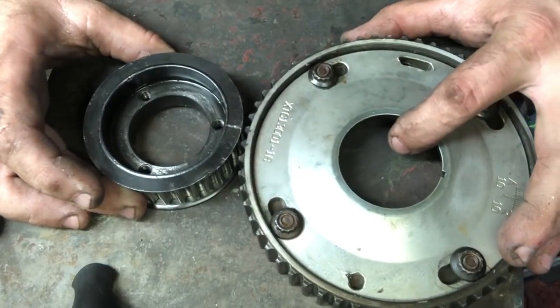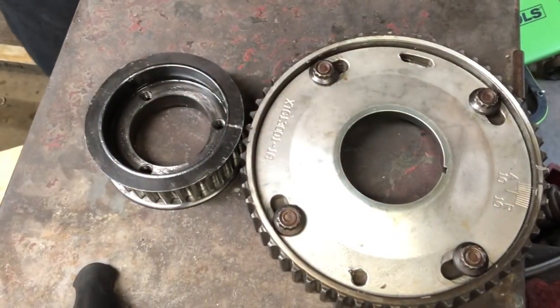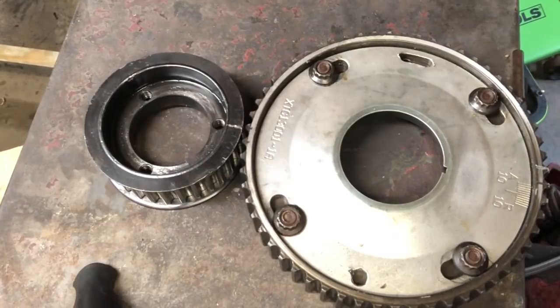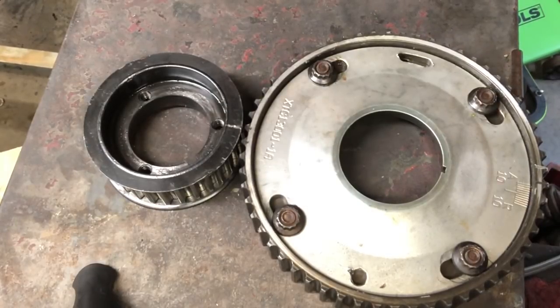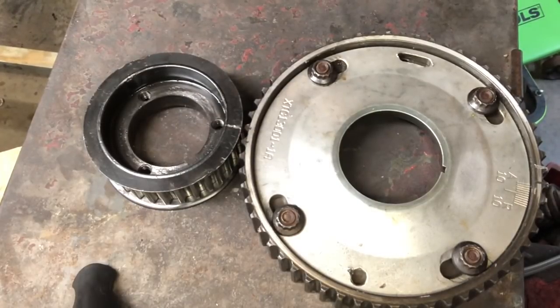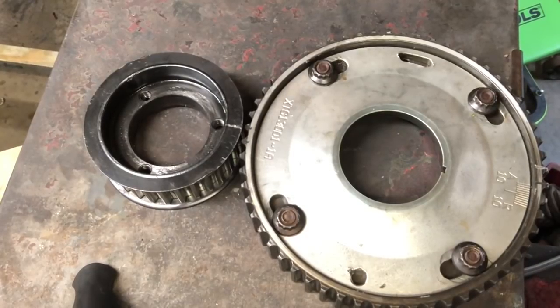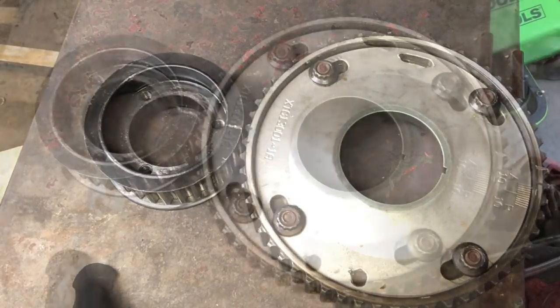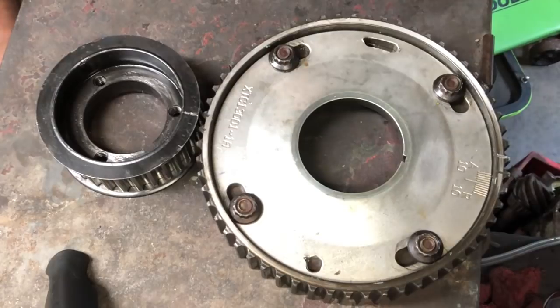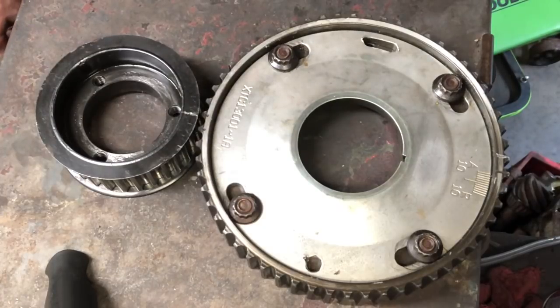The slack in it could put you one or two degrees off — this is very precise. A lot of people just guess and assume everything is perfect. But if the cam gear is off one degree advanced and the crank gear is off one degree advanced, potentially you're way advanced without even knowing it, yet it's still within tolerance. Always actually check the intake centerline. A lot of people just put them dot-to-dot and roll with it, but they could be leaving a lot of power on the table.